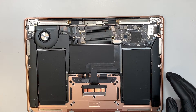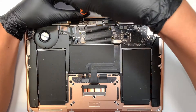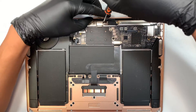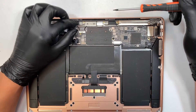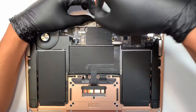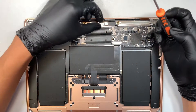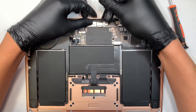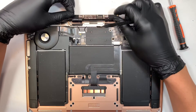The next step - you need to get yourself a T4 screwdriver. I'm removing the two screws here that are for the LCD board. Continuing, removing another two screws - those two screws are holding down the bracket, and this bracket is holding down the LCD cable. Go ahead and disconnect that cable. Now the board is free and loose.